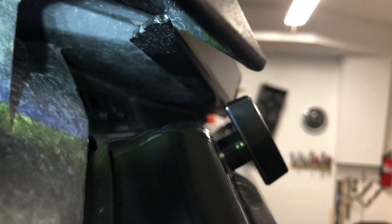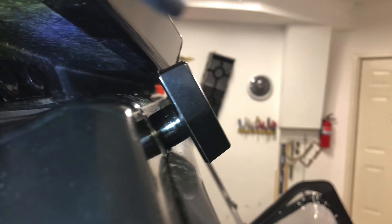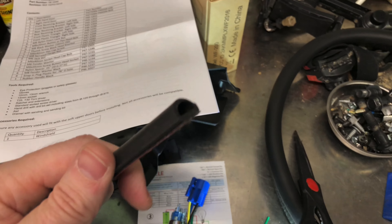I think I've got the windshield wrapped up here. Let me shine a light up in here and see if this will show up on the video. I've got the larger weather stripping on there. You can actually see right here, this is where the larger piece starts — they sent me enough to go all the way around, but I only did just this top center part since that's where the gap is. And then I also put the stick-on right here — you can see just starting right there — that is this weather stripping right here.